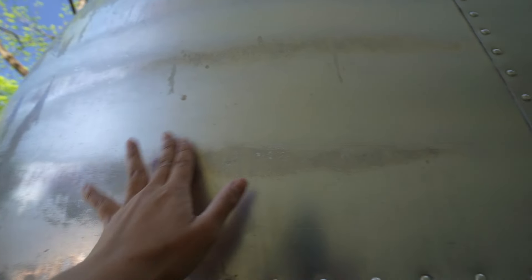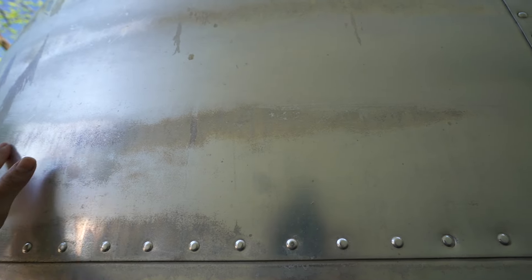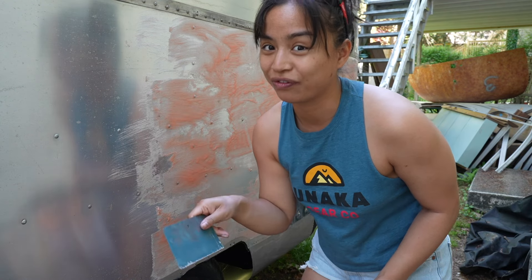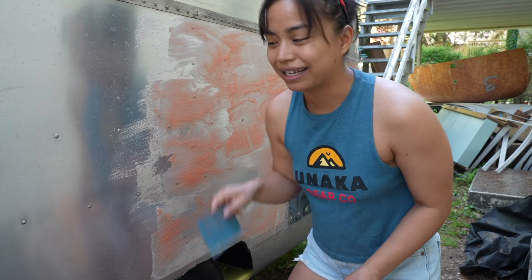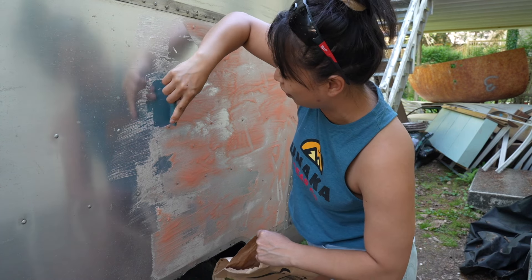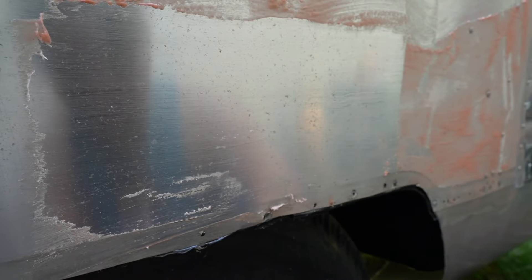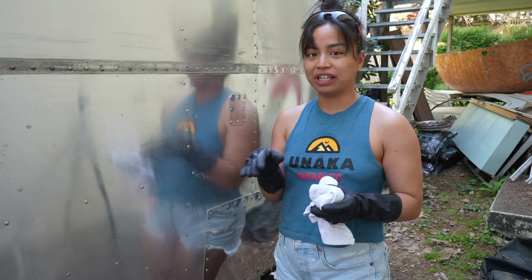You can see right here that someone tried to polish this without taking off the clear coat — you can see the clear coat right here and I think this is where they tried to polish. You can pressure wash this off but we've pressure washed this Airstream before and ended up with a lot of leaks, so I'm going to start by doing this by hand. It's also a paint thinner and we're right next to the house, so I don't want to splash it everywhere. You're supposed to go with the grain. There you can kind of see that clear coat peeling off — honestly it's looking cleaner and shinier already. This is the clear coat and this is the stripped.